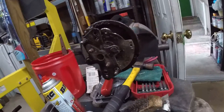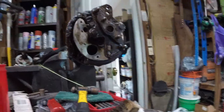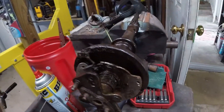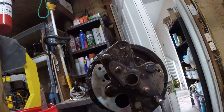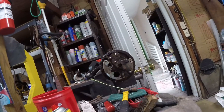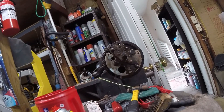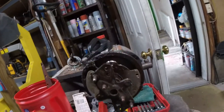I went through and kind of ravaged this thing. I took the points out of it, the condenser, all that jazz, and I've shot it pretty heavily with PB Blaster. It looks like this end piece here is put on or spun on sort of like a rivet, so I don't know how well this will come out, but I'm going to go ahead and drill that end piece out and see if I can get it to release a lot of this stuff over top.